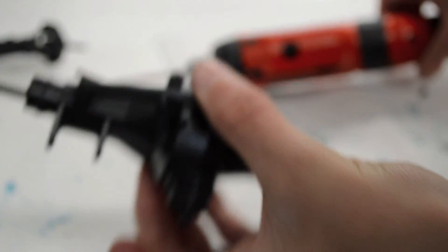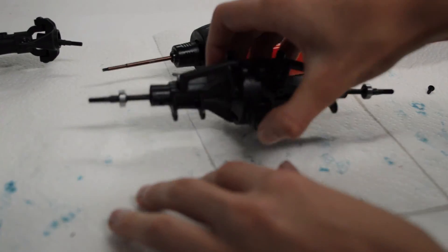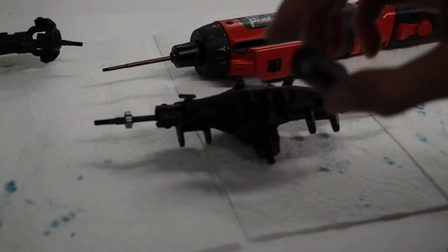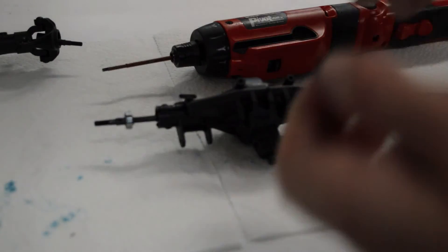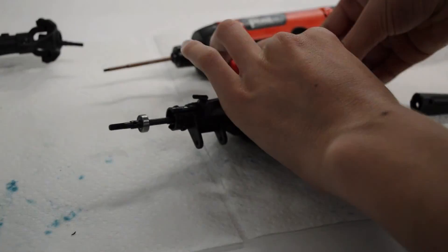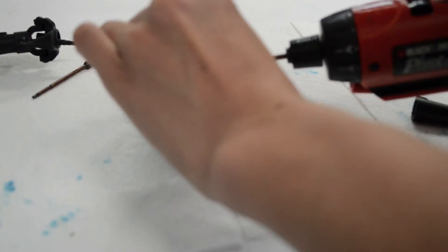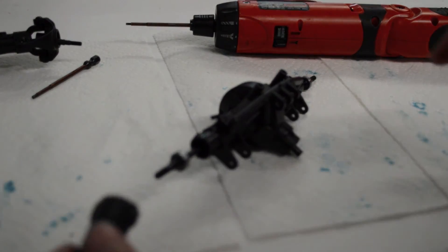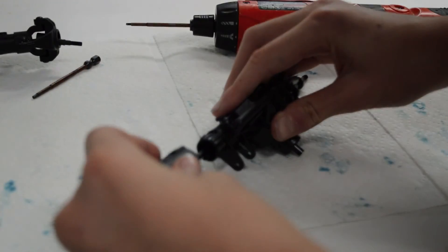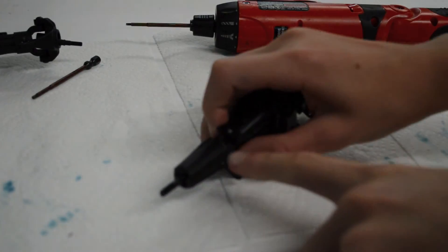It's nice and tight and the axle is almost done. You want to make sure the dog bones are nice and secure inside the differential. Then get your end caps — which I've already pre-greased. Actually, before that, get these threaded screws and secure the four-link truss right here and right here, and once that's done do the same on the other side. Now we get to the end caps, which completes the assembly. Slide the end cap over the dog bones, pinch it so it slides over the whole thing, and it should slide all the way to the inside.